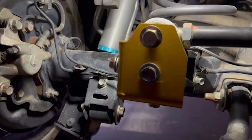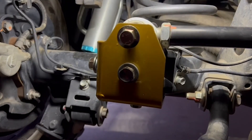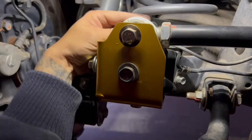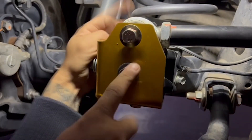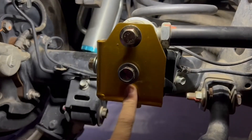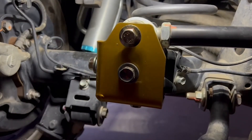The last thing you want to do is drop in the track bar, whether stock or aftermarket — just make sure it's set to factory length. Put blue loctite on both nuts. Torque this one down to about 120, this one to 100, and this one to 95. That's pretty much it.